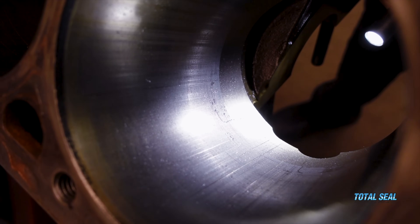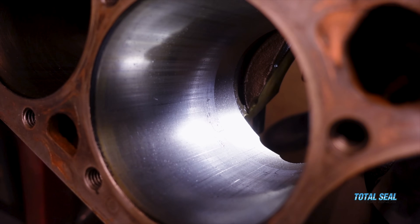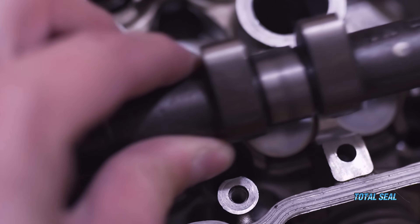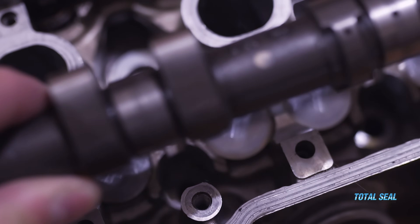The dust is very small, but you can actually see it — and if you can see it, well, the cylinder saw it too. The cylinders, the bearings, the camshaft — the camshaft held up, actually. We can't use it again, obviously — solid cam and lifters — but it held up better than we thought. Maybe that's partly because of the oil we used: it was good oil with a good level of ZDDP. So we didn't have any catastrophic failures.